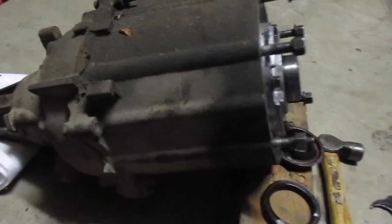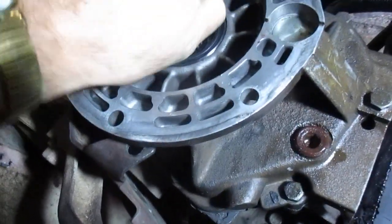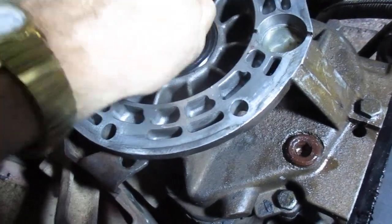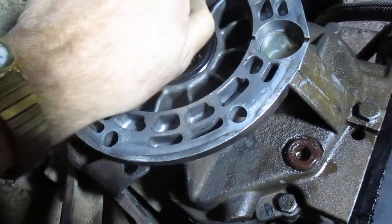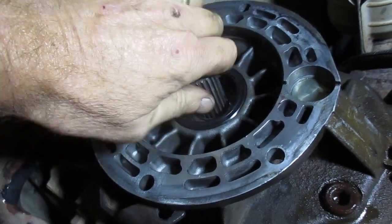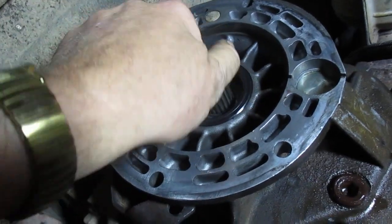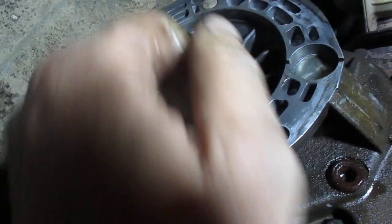All in all, not terrible. I've got no play in any of the shafts. I was really worried about the transmission output shaft — basically, it's real technical: you try to move it, and I got no movement on this shaft, which will tell you if your bearings are going out. The transmission doesn't sound terrible; it's just got a bearing whine in it. I think as I cycle through and change the oil a few times and get good oil in it, that's probably going to go away. I've done it before.